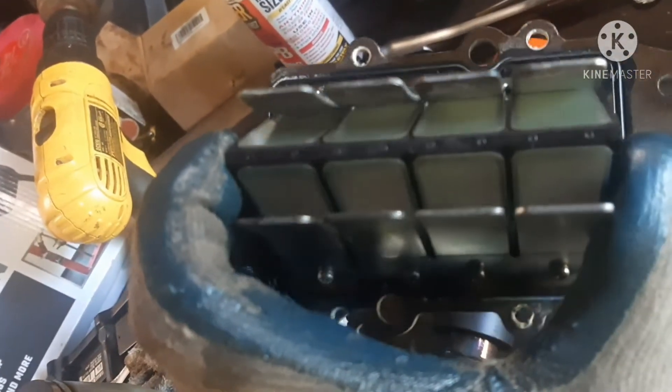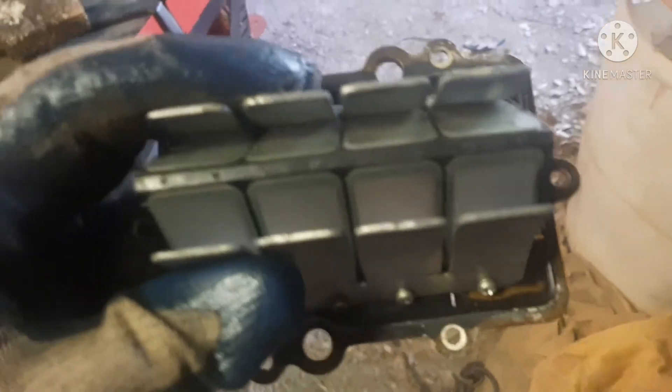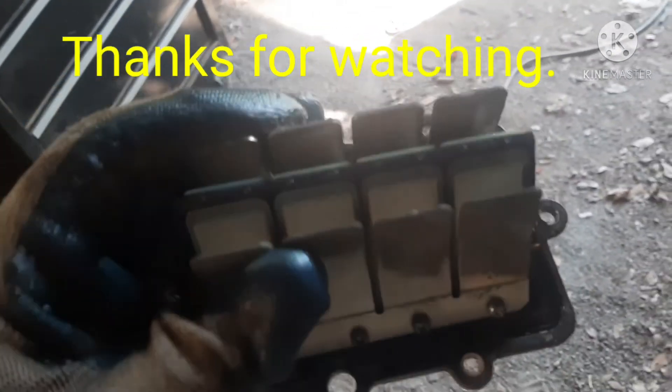They're not chipped, they're not warped anymore. Just to prove it, here's the other set — I'm not lying about this. There's my other set; they're fine. So the heat gun trick worked. I'm going to put it in, and I don't think it's damaged the properties of those reeds at all. They're not yellow, they're not split, they're flush. I'm calling that good and going with it. These are changeable in the ski anyway — they're not that hard to get to, but it is still a process.